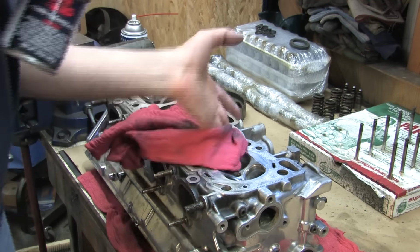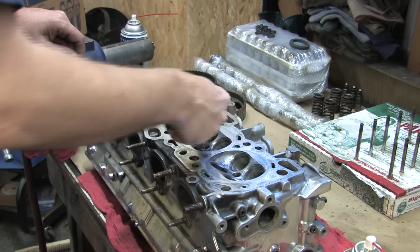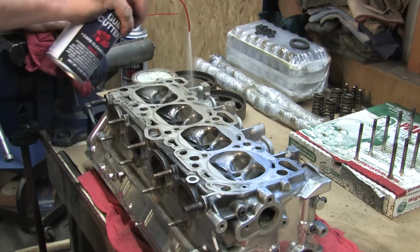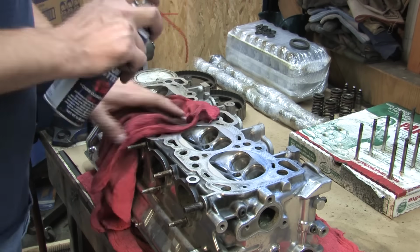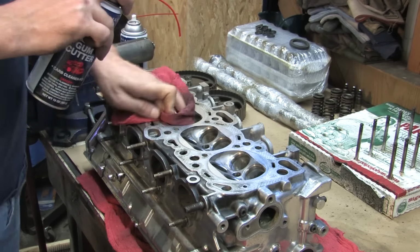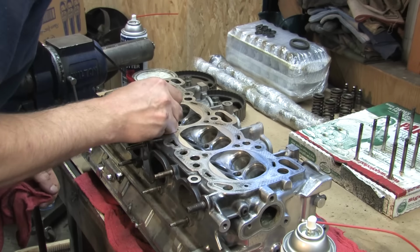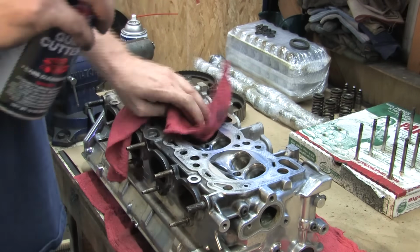warn those of you who do what I do. Those of you who have used it know its value on jobs like this. It's not chlorinated, it's got much worse stuff in it. Acetone, toluene, xylene, ethylbenzene, it dissolves carbon on contact. Do not use this in confined spaces without ventilation if you value your reproductive organs, central nervous system, and your respiratory health. This stuff plus a nylon brush is all it takes to make real short work of the combustion chamber. Then you can quickly bail out and leave the scene while the vapor's clear.